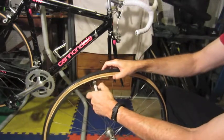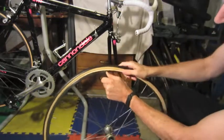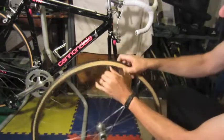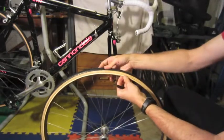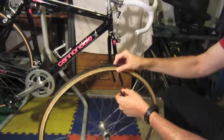You can see the crumbs falling out of there too — that tells you this tire is old, what we call dry rotted. You can see just the crumbs falling out; it's in pretty bad shape. Although it looks good on the outside, the tire is 26 years old, it's dried out, the rubber is not supple, so it's not a good tire to be riding on.